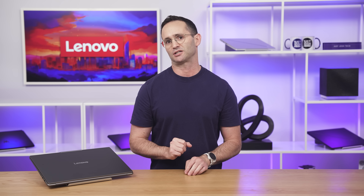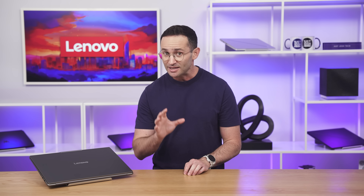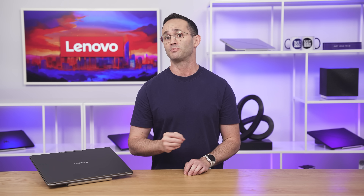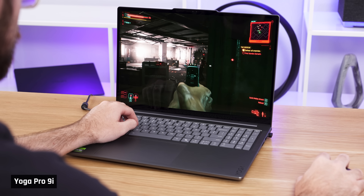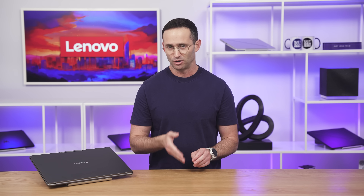After the team told me about this, I reached out to Lenovo. They said this was by design, so they could bundle a smaller and lighter charger with the laptop, but there is a larger charger available that solves the issue. I'm not happy about this — most people expect that plugging in using the included power brick won't drain the battery, and this can put wear and tear on your battery. For long-running heavy tasks like gaming, you really want to buy that other charger or consider another laptop. Short bursting tasks like programming will be fine, especially if they only hit the CPU. Overall, we feel Lenovo should give you the option of the higher-wattage charger when buying from their own store and clearly explain the pros and cons. The Asus Zephyrus G16, by comparison, doesn't have this issue because they bundle it with a higher-wattage charger.